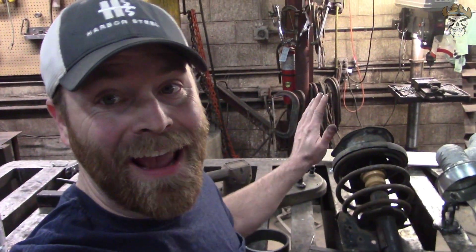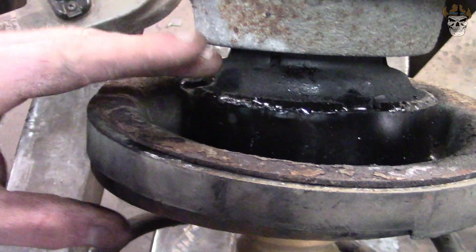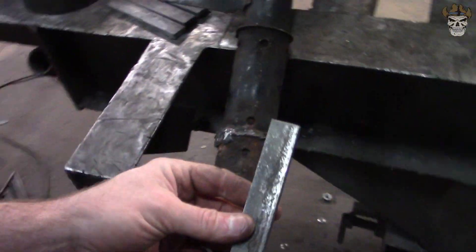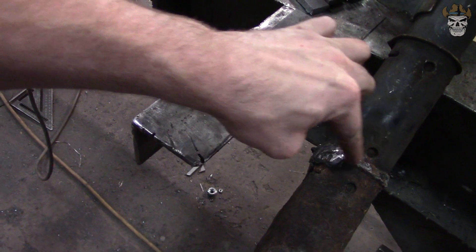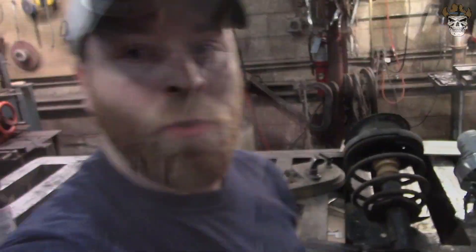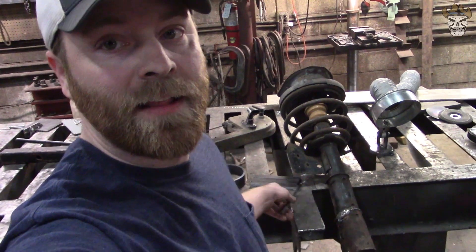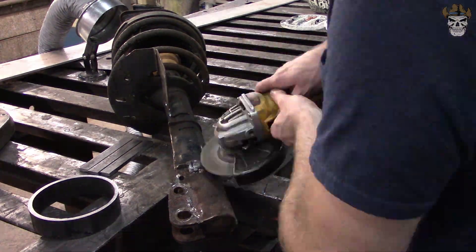Well there we go, Rednecks. That's quite the relief — I'm glad I got that done. As you can see, here's our spacer right here. That spaces the bucket, or the top hat, down, which kind of preloads the spring a little bit. Now I found these scrap pieces of steel — I'm going to weld one to this side and one to that side, and that will bring these two pieces together so it's not just one point where they're joined. This will displace the load across here, because when you've got a side load on your tire, it's going to want to fold this strut. So having these two joined together is going to be a pretty big deal. Let me get this weld cleaned up and get these things welded on.